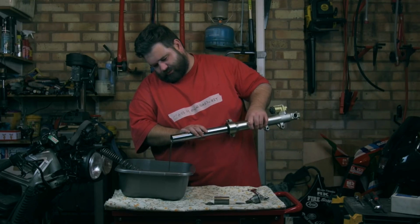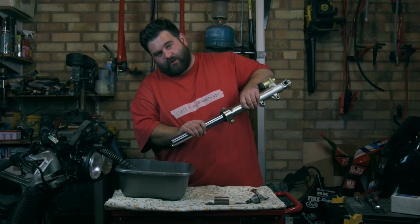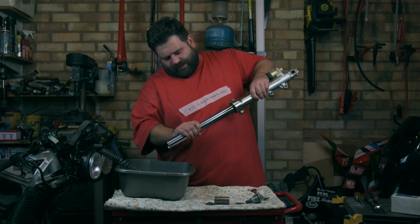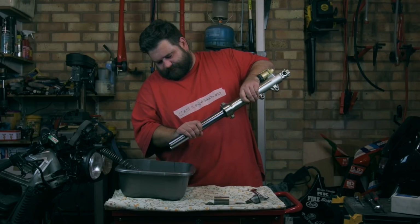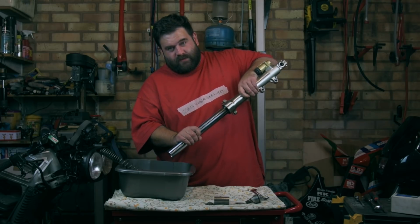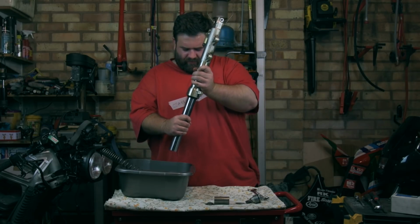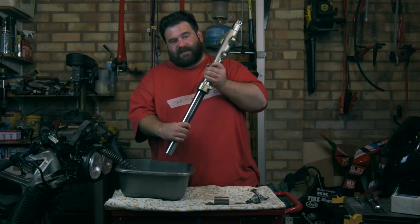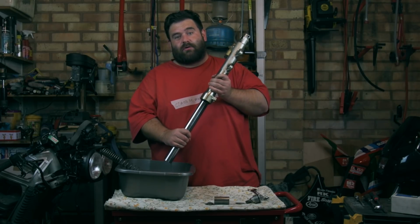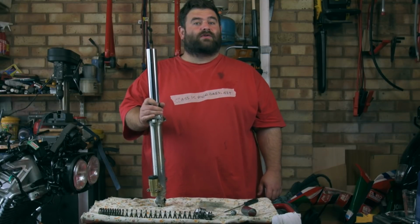Yeah, not bad. You can tell it got used a couple of times. So what we have to do is slide the fork out, push it in a few times just to make sure we get all the oil out. Now it can take a while for the oil to drain out, so we'll come back to you in just a minute. Okay, so I let the fork drain overnight just to make life a bit easier.